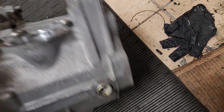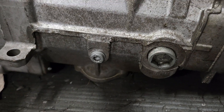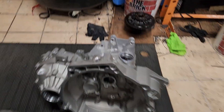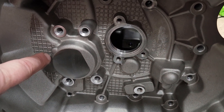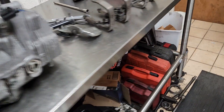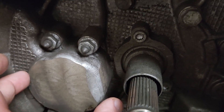Other minor changes - on this casing there's no bolt that sits right here, but on the 02S there is. That's actually for the reverse selector's upper bearing support. The probably biggest challenge of all: you can see where the pinion bolts into the case here - this is actually a much smaller part of the housing on the 02J than it is on the 02S and late 0A4s. The bearing is actually completely different on the 02S.